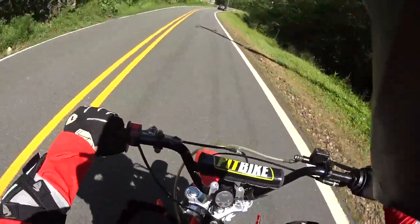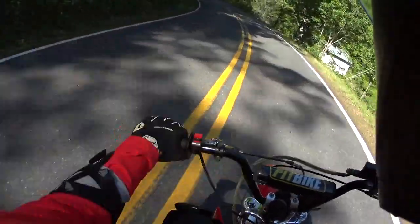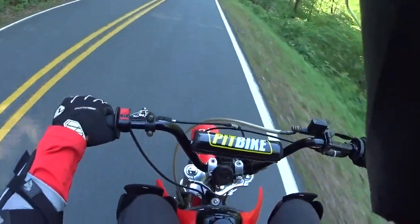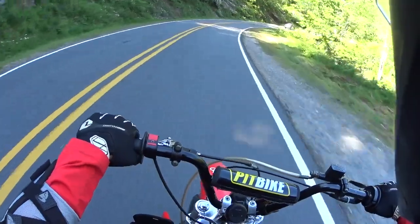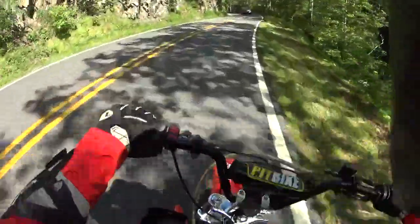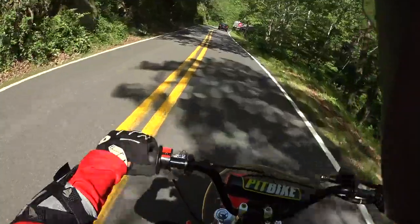I talked about it in my other video, my first motovlog, so I won't touch too much on it here, but if you're interested in getting your Coolster 125 to get the rear shock to perform the same way that the front forks do, if you have the 214FC model, because the front forks are really plush, they're long travel, they come up slow, the rebound is pretty slow. But that's not the case for the shock that it comes with. The stock one is like a pogo stick. It just bounces you right back up really fast. And it's hard to ride like that. So I highly recommend those two upgrades. And I'll be doing a walk around review of all the upgrades and all the features that this bike comes with that a lot of the other Chinese pit bikes just don't have.